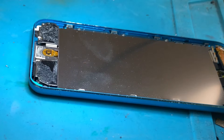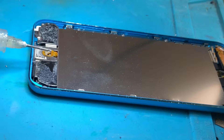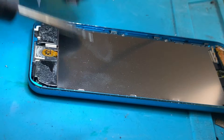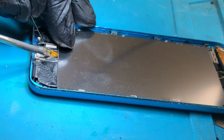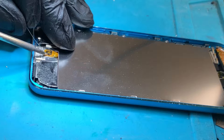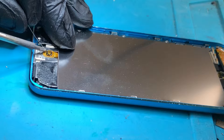I'm back now with the iPod. I'm going to put a little bit of flux over here, then get some solder and put that over the top of what's there to make it low-melt so it comes off a bit easier — same as I did with the iPad one.